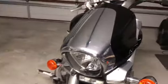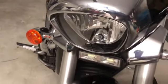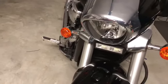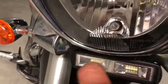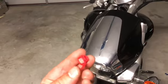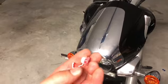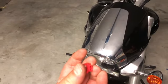Finally got the LED installed properly and put the casing back on. In a previous YouTube video, I had mentioned installing temporarily this spotter light by using a 9-volt battery that I just connected at the back here through some cables. Hardwired it to this bulb's wiring using connectors like this. Really good because you just put the wires parallel to each other, then push the blade down and then clip it and it's done. So I'll just turn it on,